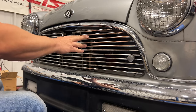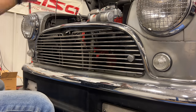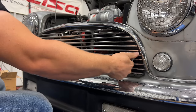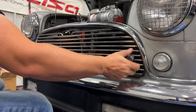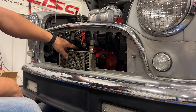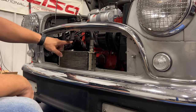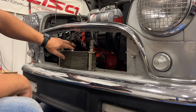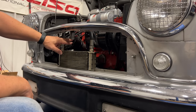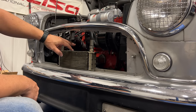First thing I need to do is get this grill off. Luckily, this one has the quick-to-remove knobs that just let the grill come right off. Here's the distributor and the distributor cap. You can see how if you're driving this car in the rain, with all the water coming in directly through here, that it could be a problem. They do make rubber boots that can cover everything and keep the water out, but those rubber boots make it a real pain to service the car, so I prefer to just put electronic ignition on it.